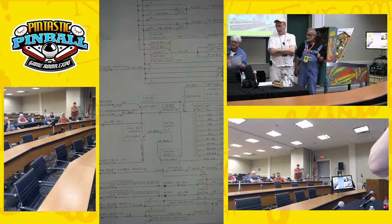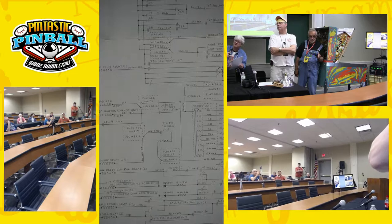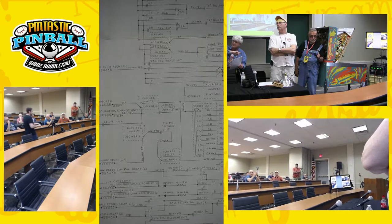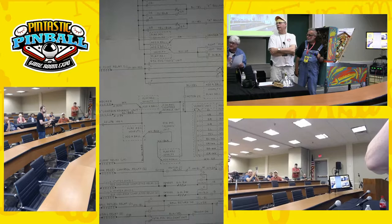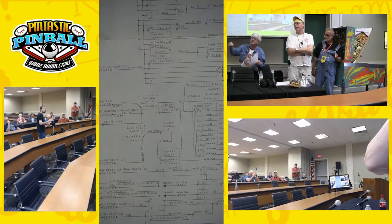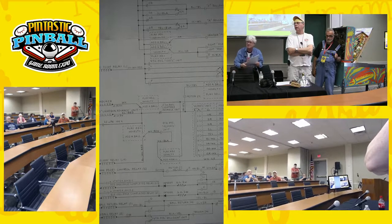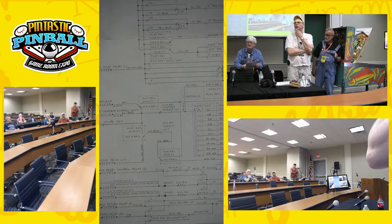It's like bonus balls in some modern games — Gilligan's Island, for example. It has a separate stack. If you have one ball to play on the main ball count unit, you can only work your way up to six. Unlike an American addaball where you could run up to nine, on the Italian system you can have no more than five stacked up. You can go up and down, but once that drops down, the next time you cross the drop switch you're subtracting from the balls to play. The key thing in the Italian system: balls to play only steps down, never steps up.